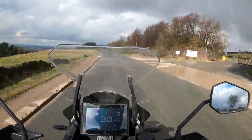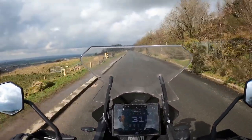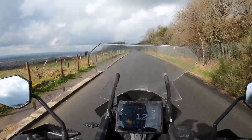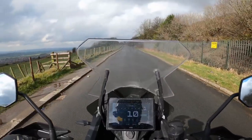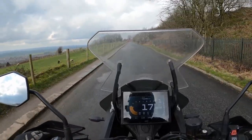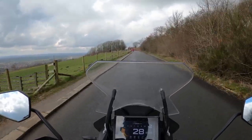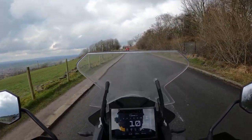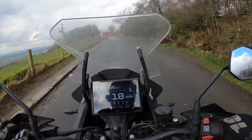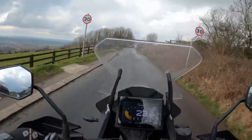Right, so I'm on a quiet road here, 30 mile an hour, second gear. I've already disabled the anti-dive, so let's see what happens. You instantly feel the difference, so turn the anti-dive back on. Same again, we'll get up to 30 mile an hour, second gear. And there's nowhere near the same amount of movement. Feels a little bit strange initially when you first start using it, but you very quickly become accustomed to it.